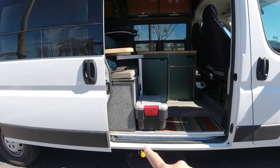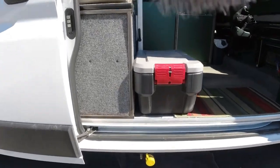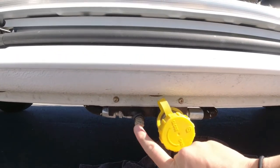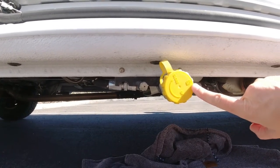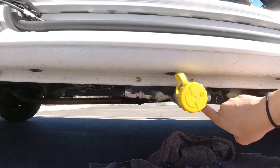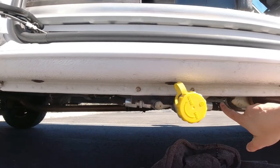So this valve is what I'm talking about — that's the extension kit where it pops out right next to the side of the van, right underneath the door. We essentially have an extended bleeder valve and then the extended fill valve. The Nashville propane extension kit comes with all of this: the mounting bracket that mounts to the rail of the van, the updated bleeder valve, the fill valve, and these hoses.